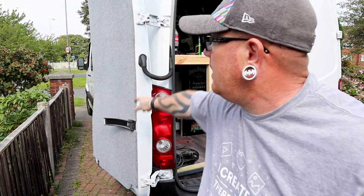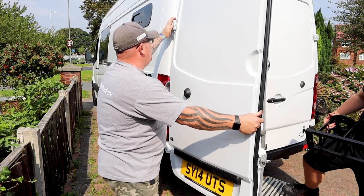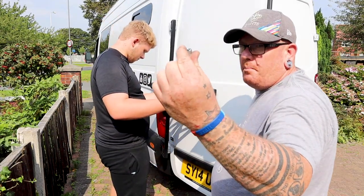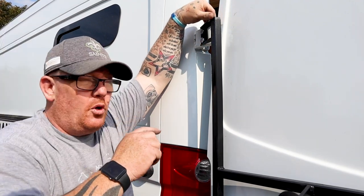The kit does come with these bolts — these go through the front and then bolt in the back in there. You've just got to lift it up — one person. Not going to work, is it? I need a helper. Once you've got yourself a helper, preferably a James or an Emma, be extra careful when you're moving the door because there's no braces in the hinges. What James is going to do is hold the rail up to the top and the bottom one. Then we're going to take a bolt. We've got our bolts in the top and bolts in the bottom.